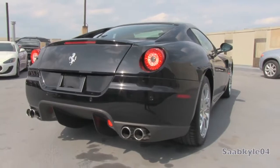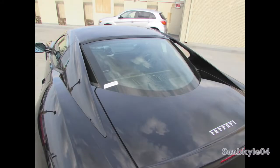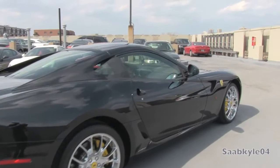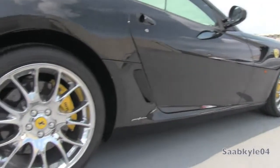In the back, cradling the curved rear glass, the flying buttresses, already a pretty unique styling cue themselves, help channel air over the upswept deck lid. This helps reduce lift by 110 pounds without adding to drag, with an already low coefficient of just 0.34.